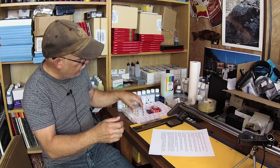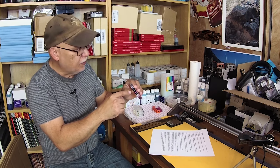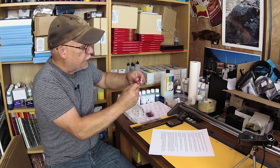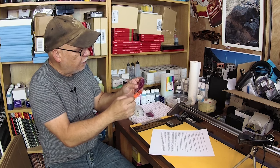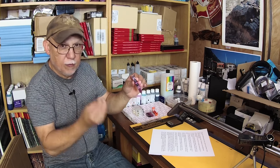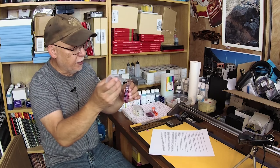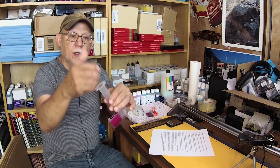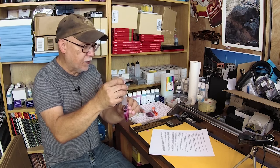What I recommend is to begin your flushing with Windex. Windex is so much cheaper and it contains ammonia, which works really well to dissolve ink residue. Load up a syringe with Windex — here is a dried-up cart that has not been modified. Here's one that indeed has been modified. You remove the plug on your modified cart, then load up a syringe with Windex, insert it into that hole, and push in your Windex. Once your sponge has absorbed a quantity of Windex, let it sit for an hour or so.